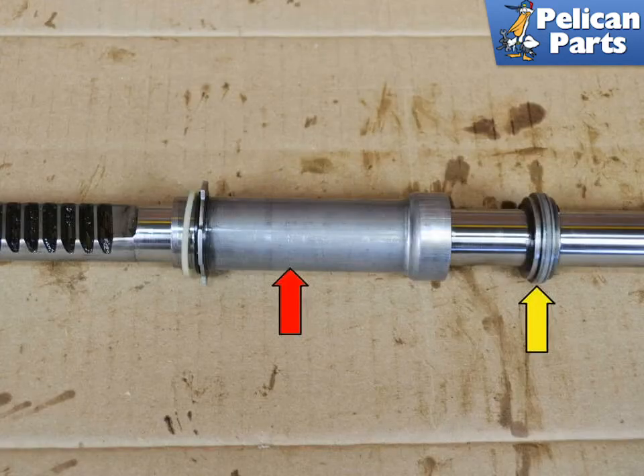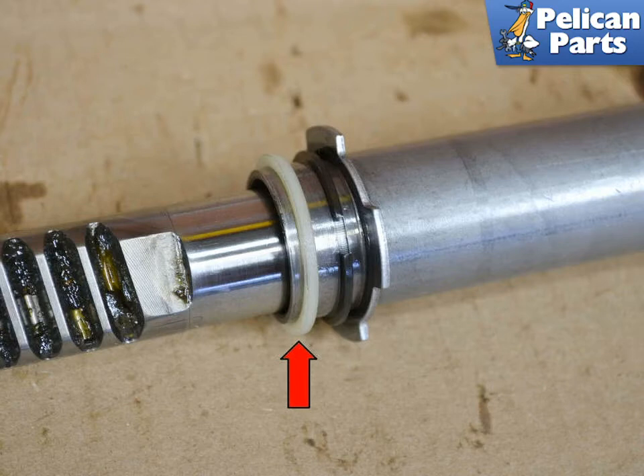To remove the sleeve from the rack, you will need to remove a series of circlips, washers, and gaskets from the rack. The sleeve cannot be removed from the geared section of the rack. The end of the sleeve next to the geared section will have a circlip, a teflon washer, and an o-ring. Sometimes the o-ring remains in the housing — do not forget to remove and replace it. Do not lose the teflon washer; there is not one in the kit.